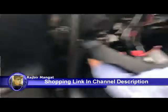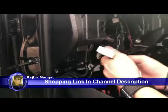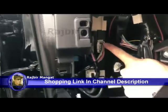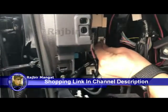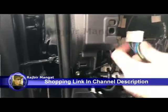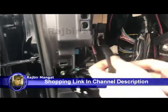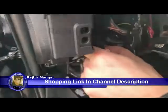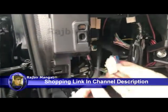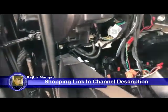We'll pass them on the underside of this panel and up to the black ECU connector. Pass that wiring up in here. You're going to see the second black ECU connector — this is the bottom connection at the top. We're going to go ahead and just do the black connection. We're going to have to pull it out. Go ahead and plug the Stardex harness and put it in place. Make sure to put it in until it locks. Then you'll go ahead and plug in the original factory harness and put it in place, just like so. That's the second connection.